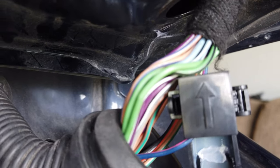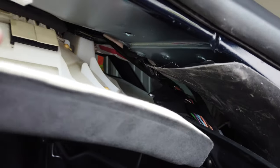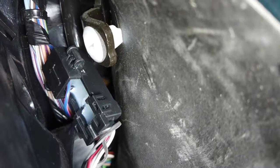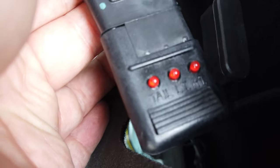This wire — a blue wire with a purple stripe going down it — there are 25 wires here and luckily the fifth one I tried worked. It goes in here into the car and then underneath this headliner there's some metal, and I was able to trace it on the inside. It was this bundle of wires that comes down here. I was able to put the clamp on that same wire down here. I just tested the lights and it works. Lucy, can you go ahead and turn the headlights on? There you can see it's on. And go ahead and turn it off — and it's back off. That's the tail light, so that's exciting.